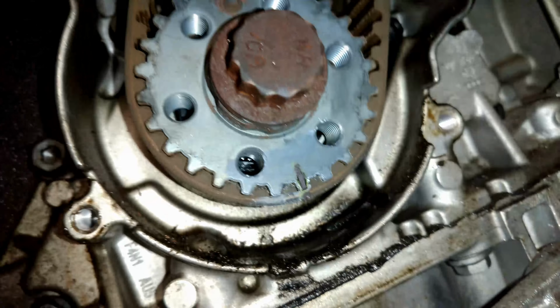Coolant is draining, but not the way they told me to do it. So I'm going to explain that here real quick. As you can see, the coolant is draining from a location other than what the document specifies. Basically, the document says that you should drain from this upper radiator hose right here, right below this little air tube kind of thing. Well, that was really difficult to get to, if I'm really honest. That hose clamp was really hard to get off, and then after I got it off, there's a lot of pulling you gotta do to get that off, and I got a little bit of coolant from that, but this looked a lot easier, and it's a lot lower in the cooling system for sure.